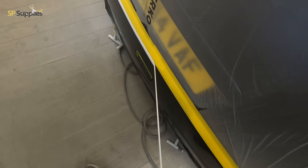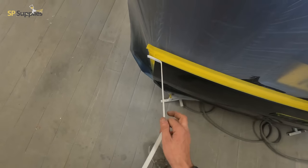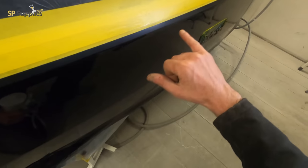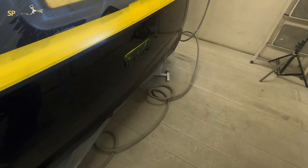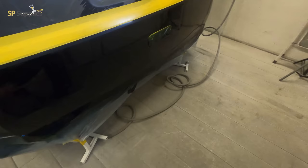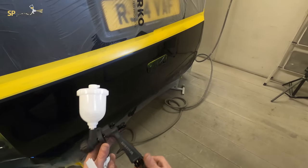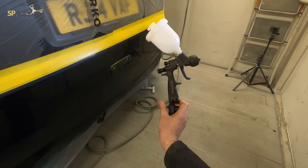A little tip for you guys when taking this blend edge tape off: don't pull it straight off — stretch it like I'm doing here. It'll pull off really clean with no glue residue behind, and it's a lot easier and nicer to remove without risk of it touching the paint. You can see that tiny little fade-out edge there — just a quick bit of rattle-can fade-out thinner across there and you'll be absolutely spot on. I hope you guys enjoyed this week's video — see you again next week!